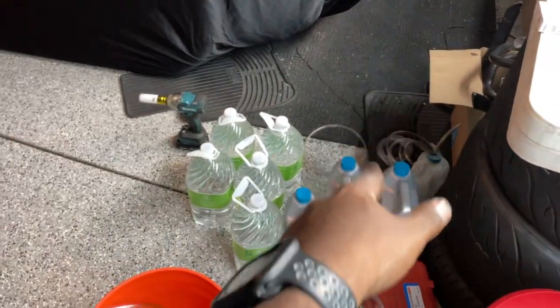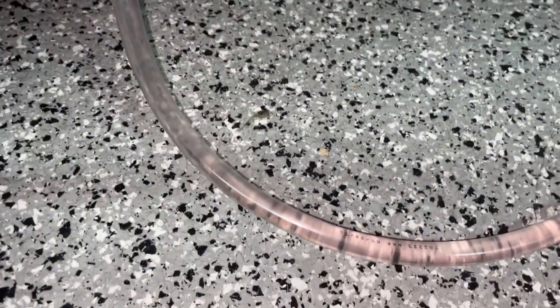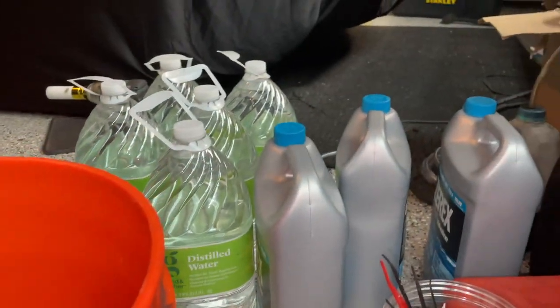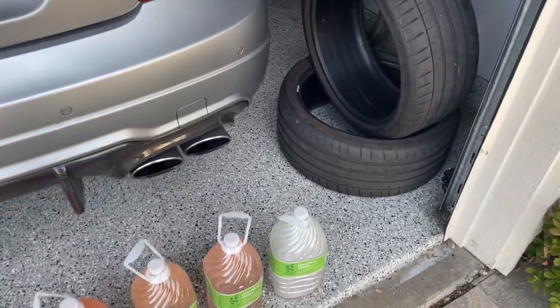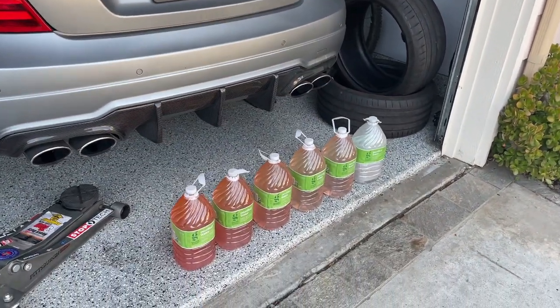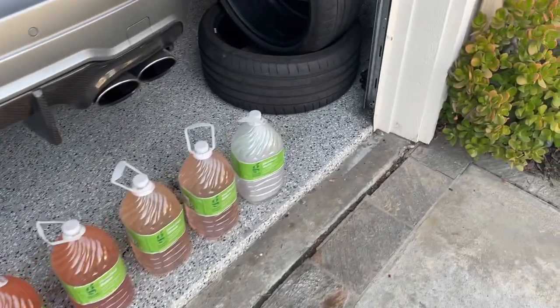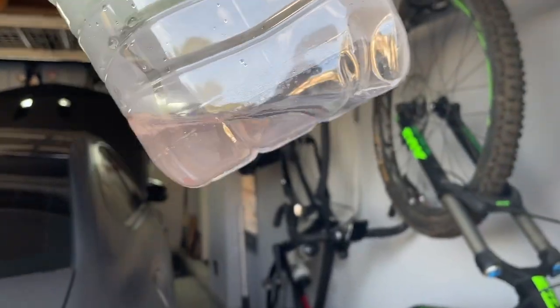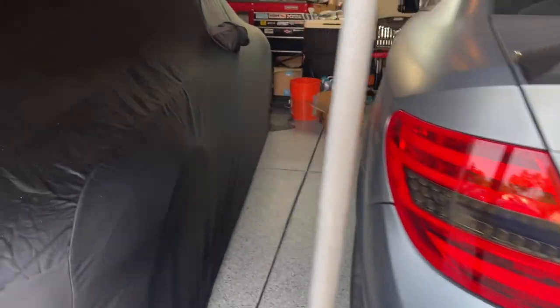Got the cap off, ready to drain for round two. It's looking a lot clearer but still a little pink, so we'll do one more flush with more distilled water, run the car a little longer, let it circulate, and then repeat. That took — let's see — about five and a half gallons, or closer to six or seven if you account for the initial waste bucket. Looking at the very bottom of the bucket, it's about as close to clear as we're going to get, so it's safe to go ahead and add our Zerex G48.